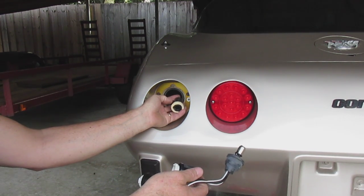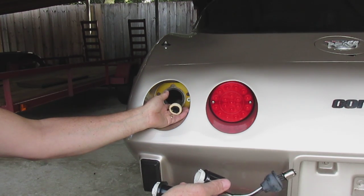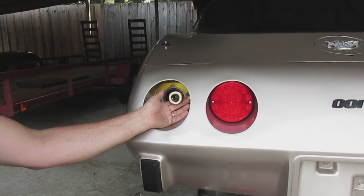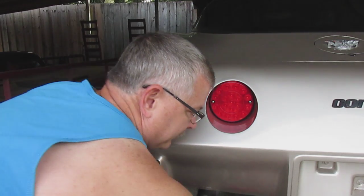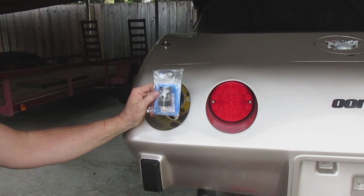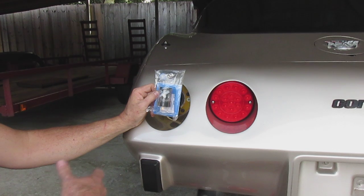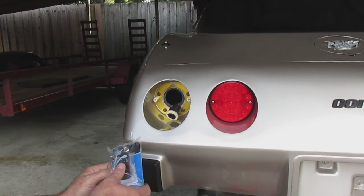Since my sockets are fairly new, I took the seals off the Y-adapter and put them on the housing, so I'm running a double seal to make a nice seal on the back side. With just one seal it seemed a little loose and would probably let moisture in. As for the electronic flasher they gave with the kit — to flash LEDs, the load on these bulbs may not be enough to make a thermal flasher flash properly. I already had a heavy-duty flasher in this car; those are really made for trailers with extra load and they flash at a regular rate regardless. That works fine, so I'm going to leave it in and keep the electronic one as a spare.